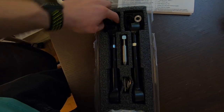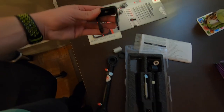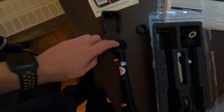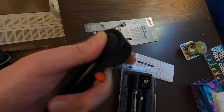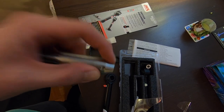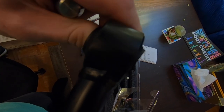Now I'm not going to take everything out — I'll take out one side for you guys. It comes with the bracket; the bracket goes on top. If my finger was the sway bar, the sway bar goes right here. You mount this in there and then stick one of these sleeves inside of your spherical bushing. These ones are actually like ball bushings on both ends. The ball bushing is supposed to help when you're throwing it onto your disconnect pin, which is tapered. Depending on your angle, if you're not perfectly level, it helps you slide it on.